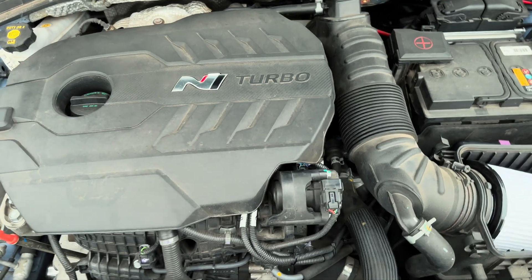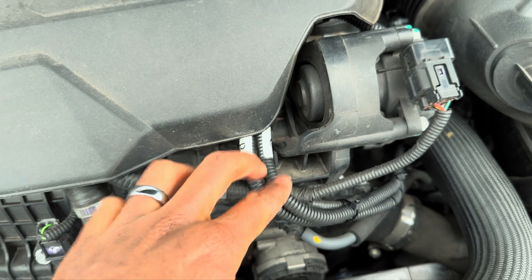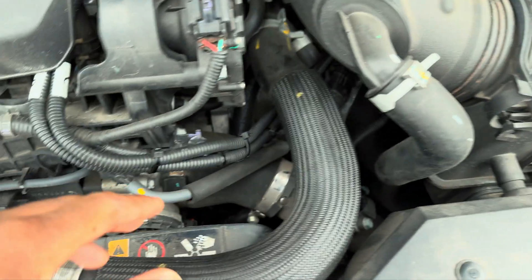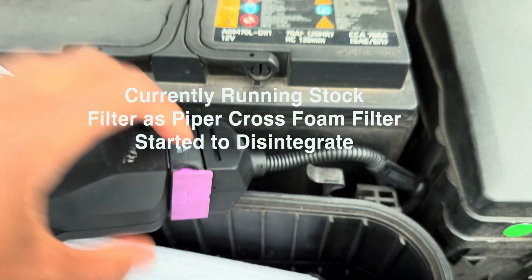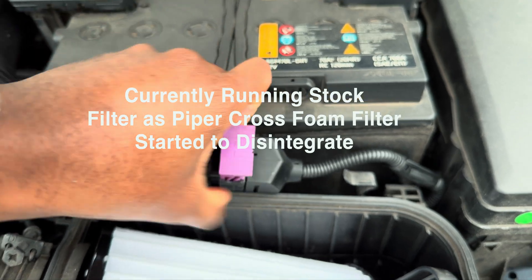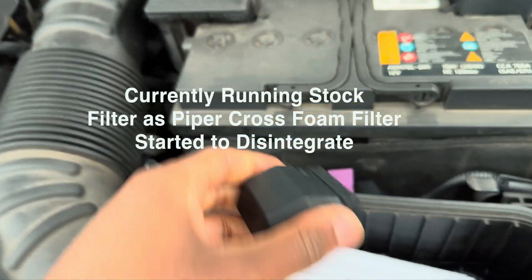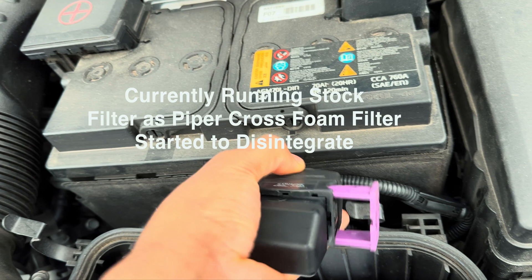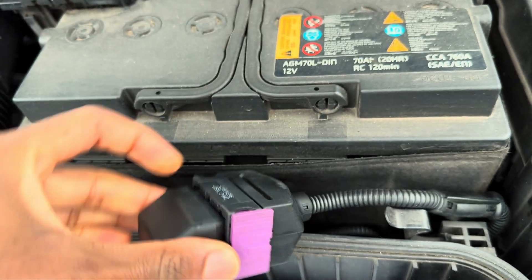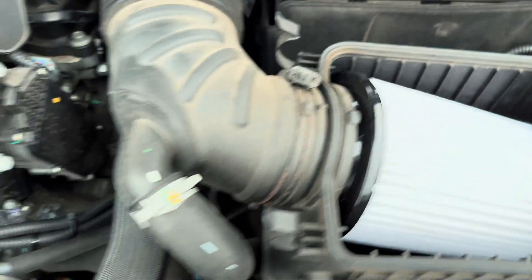Here are the harnesses for the race chip — it's pretty neatly installed. I've got it back here, and when the light is switched off it means it's deactivated. I can pull this tab, pull that out, and install the blank adapter instead. That should put it back to standard.